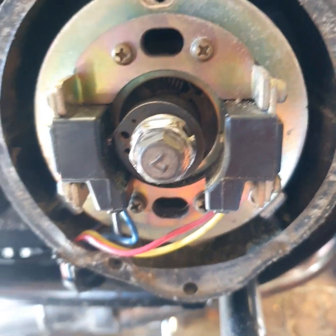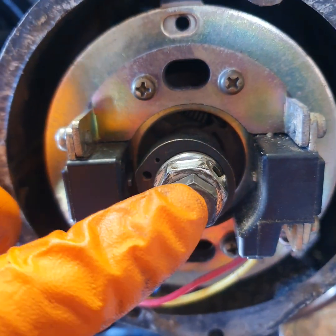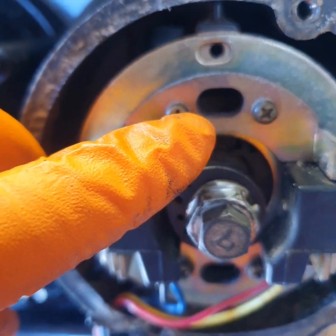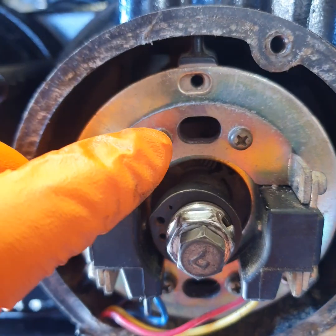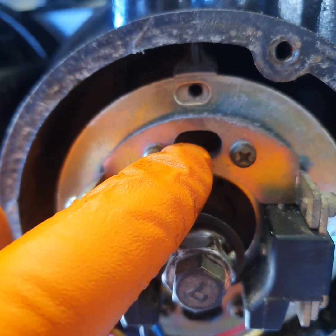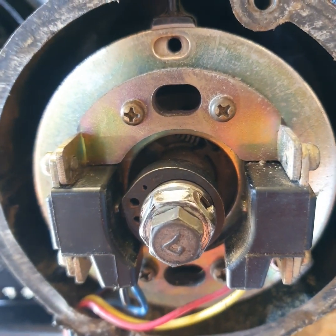This is achieved by, through this little slot here, turning the crank — there's a bolt in the centre which is loose now — until you see the T mark in there. What I'll do is take this plate off and show you in better detail what it should look like. But basically you have to look through there, turn the engine over by hand, and just make sure that it's set at TDC.